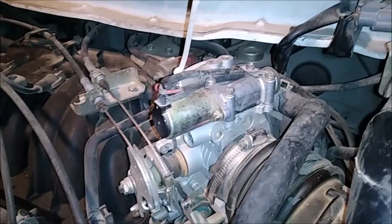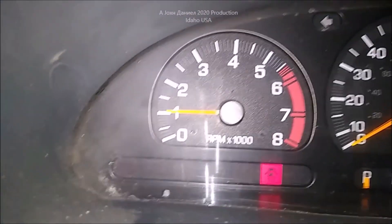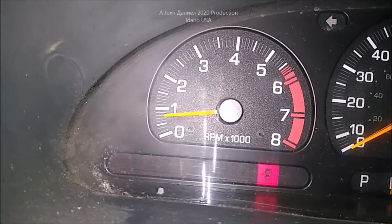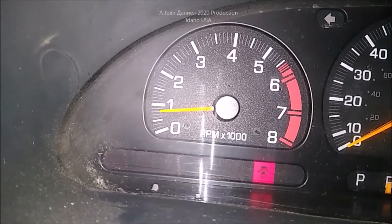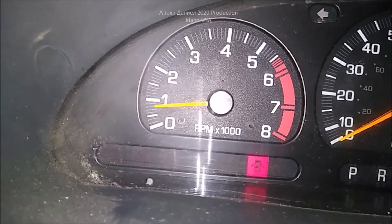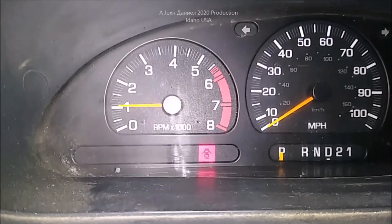All right, with it back on we have an engine that's idling right, sounding a lot nicer. Instead of it dropping down to about 600 and stalling out, it is now idling at about 1,050. And there it recovered — now it's running at 800 like it should. Put it in drive — 800 like it should. So we gained about 150 to 200 RPMs and it's not loping. I think we fixed it.